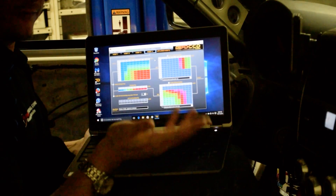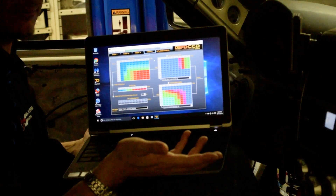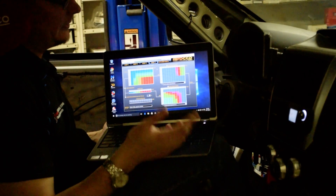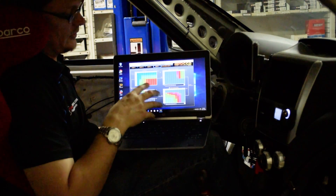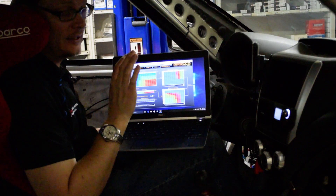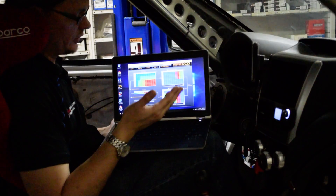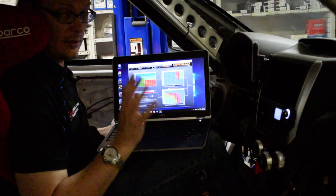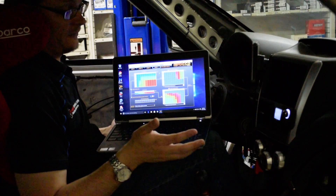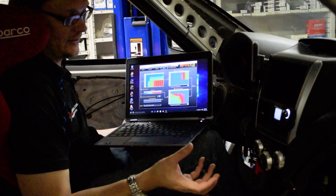They've got four different tarmac maps, for instance — one set with very aggressive lockup and one set with minimal lockup. The one we've liked the most for tarmac is the one with minimal lockup. These are their starting parameters, showing how the diff will behave, and then you can start to modify from there to get a specific behavior — turn on the left-foot braking map, or get more lockup if you're going faster when you apply the brakes. All that sort of customization is what we like best about this controller, and the fact that it's all self-contained with no add-ons to the diff.